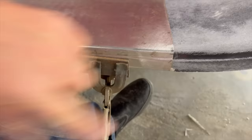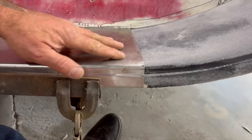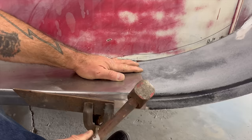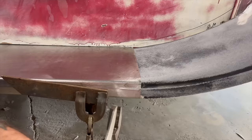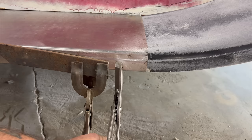That looks pretty blended to me — how about you? Take a little shot to bring this back up close. Close that gap a little bit. I'm going to squeeze this with a big pair of crimps. This is a little bit higher right here. This amount of filler to make these two come together — I'm not even concerned with that. We're going to panel bond it and rivet it because we have about that much fiberglass. Right now I'm just in the forming part of it. I'm going to get this design to flow together. That looks really good, Ian. I surprise myself every day. So we have the hem edge inside that was open — now we're going to shove it slowly without denting the heck out of this. We're going to squeeze it.